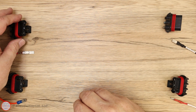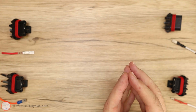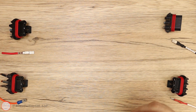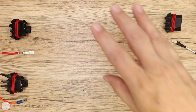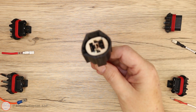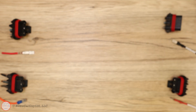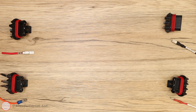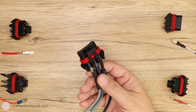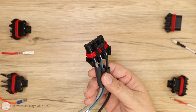One of the things you should do if you are replacing a device such as the cooling fan with a new one is check the electrical terminal connectors that are going to be reused to make sure they're viable for the replacement part. As I showed you with my Caprice, I ended up finding a replacement pigtail from a wrecking yard to replace it. With the Chevrolet SSR, there is a similar offering from Mike at Simple Engineering to replace the pigtail portion on the vehicle side of the connection.